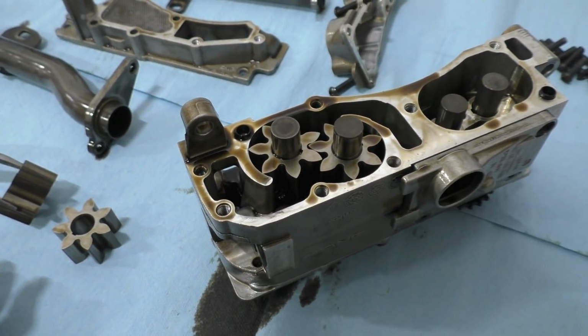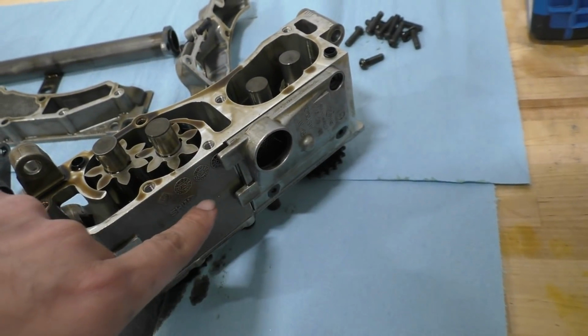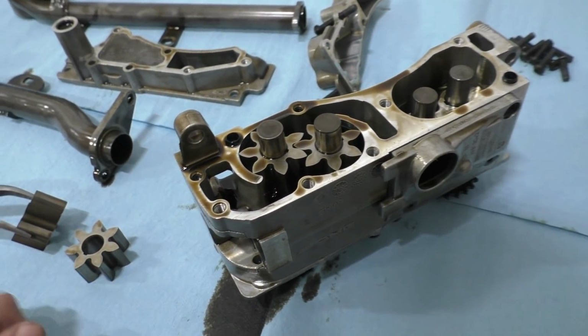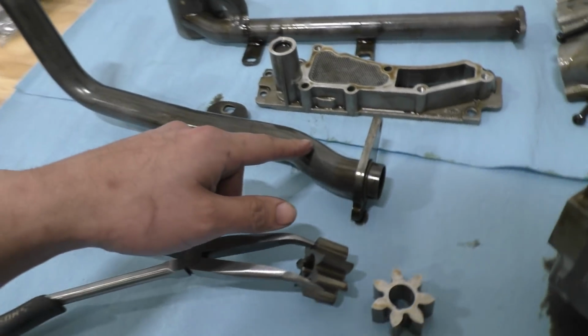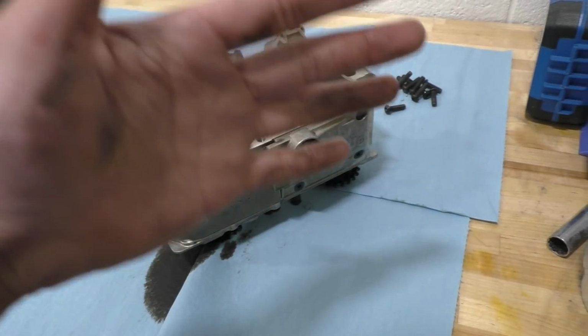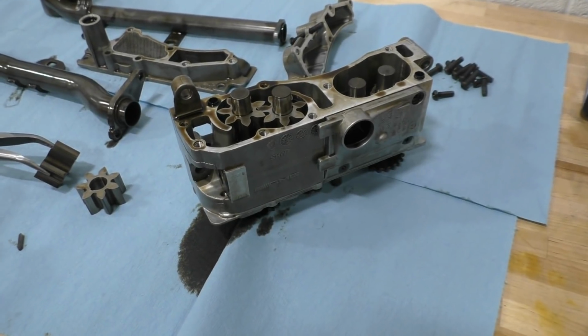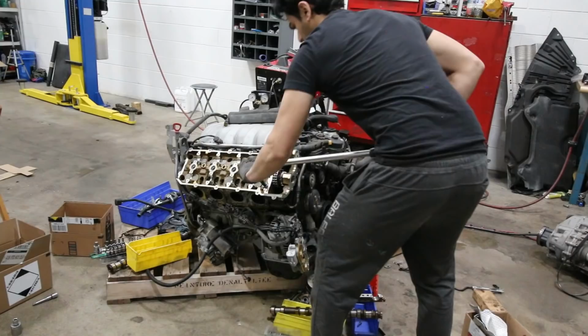Other than this, the other difference is the S-Class has this big oil collector at the bottom and the strainer over here. But even for that, all I need to do is add some bends on this tube, link it down so that it lines up with the main sump that is now going to be at the front, and then this system is going to be pretty much converted to what's in the S-Class.